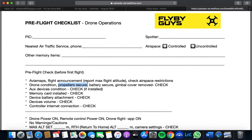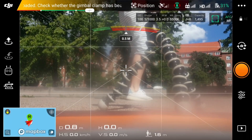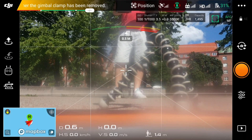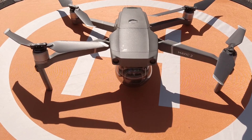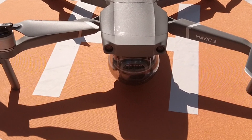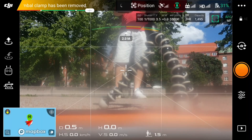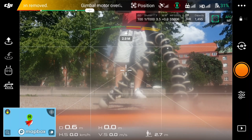All Mavic owners must be aware that the gimbal cover has to be removed. It's very easy to forget this, and if you don't remove it, it will cause the gimbal motor to overheat. If you do leave the gimbal cover on, you may have to restart the drone and then do a gimbal calibration to help the gimbal move. I've tried this, and afterwards you'll find that the gimbal is unable to move — it will be stuck. So bear this in mind; it's very important.